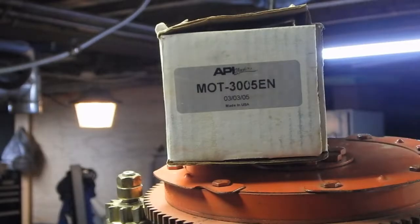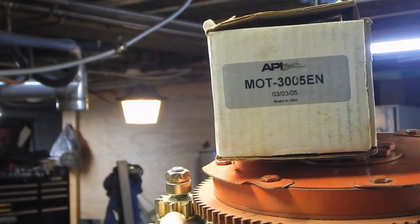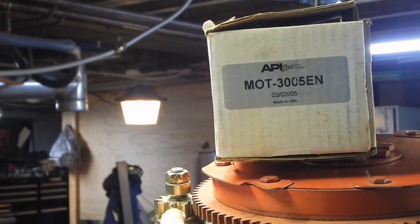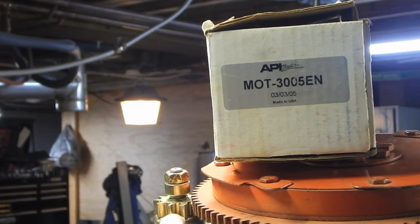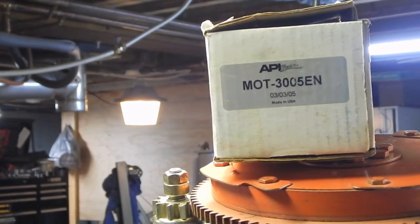I wish. But seriously, folks, the problem is that apparently right around the time that they were making this motor, somewhere in that era, they changed the size of the pinion gear on the starter, or the design, or something. So what I did today was I looked up online and I found on Crowley Marine the part number that supposedly is the part number for the original motor for this. And then I found that supposedly this is supposed to be a cross for that.